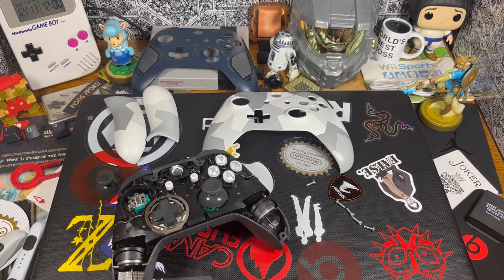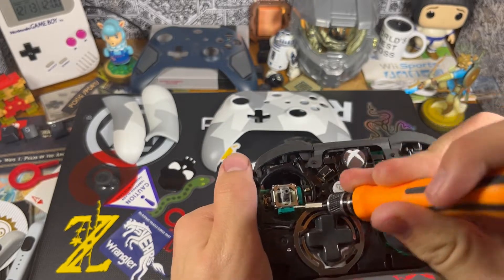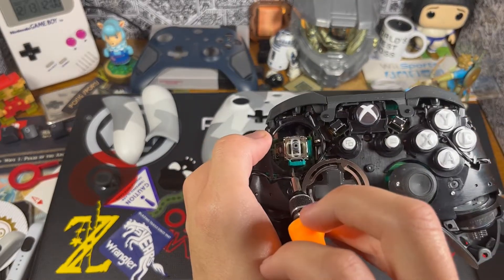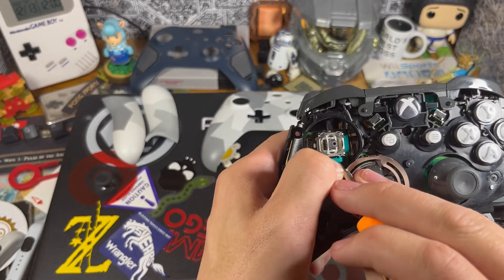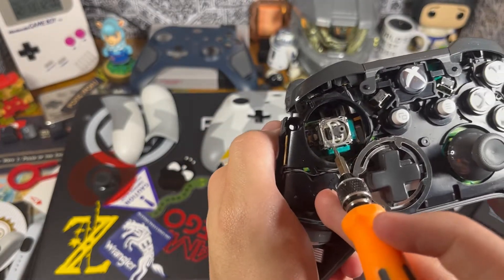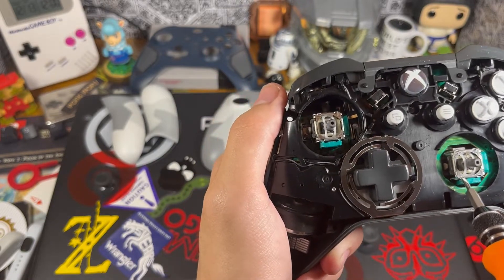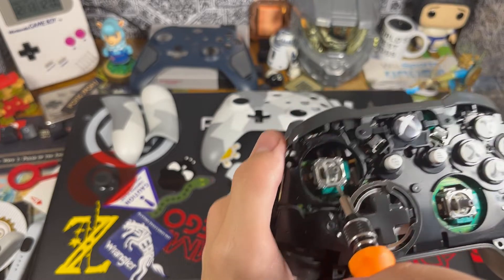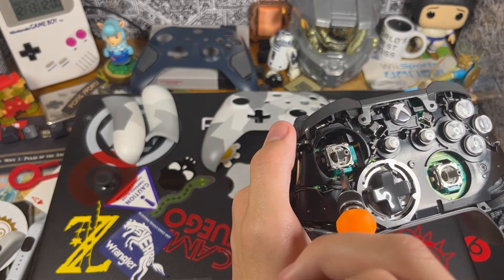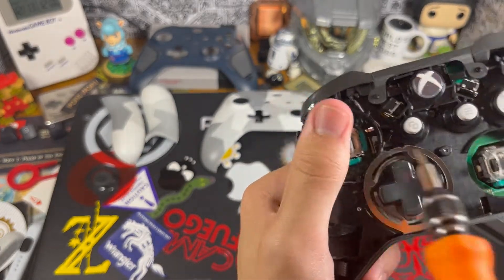Switch to a small flathead screwdriver and pop the potentiometer off. As you can see, the potentiometer is now popped out. Push it back in a little bit, but don't let it close all the way — just let it hang out with a tiny gap. Here's the factory potentiometer on the horizontal axis, nice and tight, and here's our adjusted one with a slightly wider gap. That extra space allows the sensor to move more freely, gets debris out, and that's what fixes your stick drift.